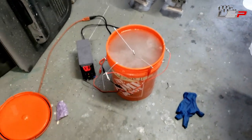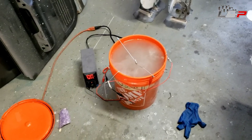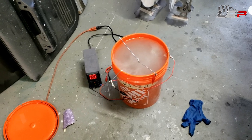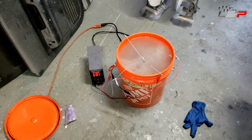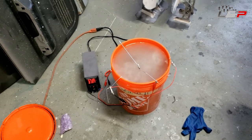I did notice on this one, the weld was slightly discolored compared to the rest of the part. I'm not sure if it's a different alloy, which probably is, and that's causing the issue or what. So we'll see how it takes color. The part is anodizing fine, but I'm not sure. We'll have to see how it takes color. So we'll find out in a minute.